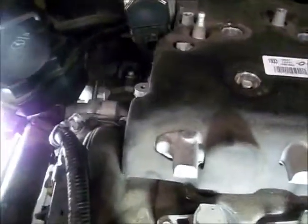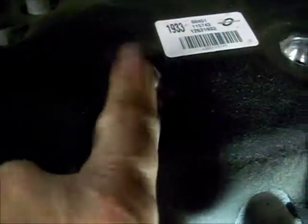I'm going to take the bolts loose in it and see if that's all I need. The intake bolts are 13 millimeter. The intake's dislodged and there's a brake booster hose here in the back. Needs taken off and the intake should be clear to come out of there. I was stuffing paper towels down into the intake ports to keep particles out of there.